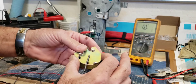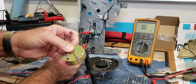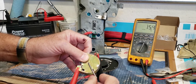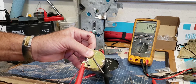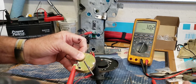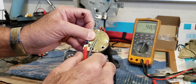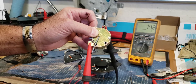Inside is a wire-wound coil with a little wiper that runs on it, and it uses the case as the other side of the circuit. We're sitting here at 10.3 ohms — this thing is not perfectly accurate, but it's close. 10 ohms should be full tank. And I've got this one adjusted down here — this little stop is 72 ohms. Wiggling it around we're really close to 73 ohms. So at 73 ohms it should be empty.